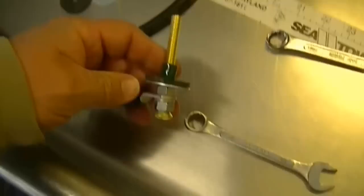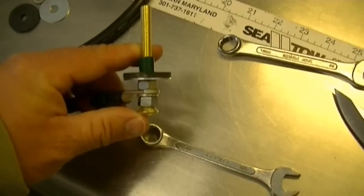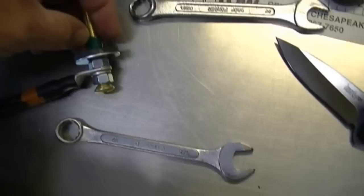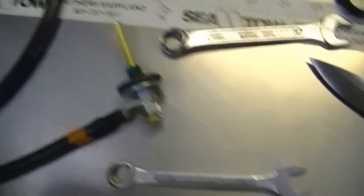I got this off the Buggies Gone Wild website — great bunch of guys there. This is available commercially, or you can make your own. Most golf cart places that sell wire kits do have this. It's just a stud you're going to make to go through that computer and connect the cables. What you've got is a bolt — a 5/16ths by 3-inch bolt — 2 nuts, a lock washer, a fender washer, a rubber washer, and something to insulate where the bolt goes through the computer. I'm cutting little pieces of plastic covers and slipping them over there, then through-bolting it and hooking the ground cable up on the other side. These cables will not pass through that hole, so I'm going to get that done now.